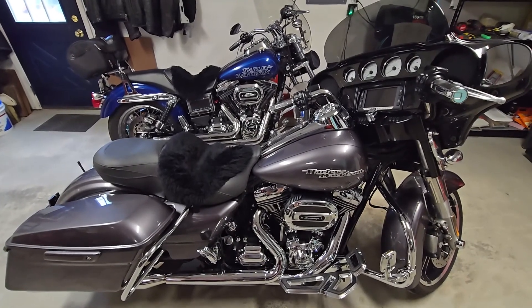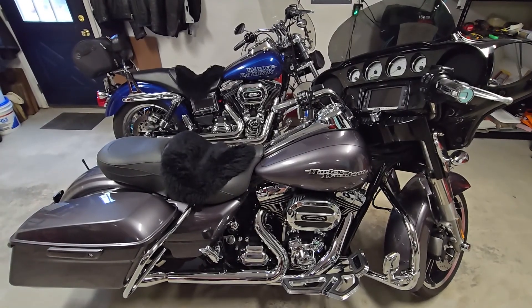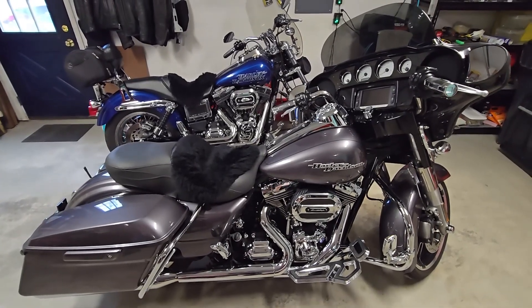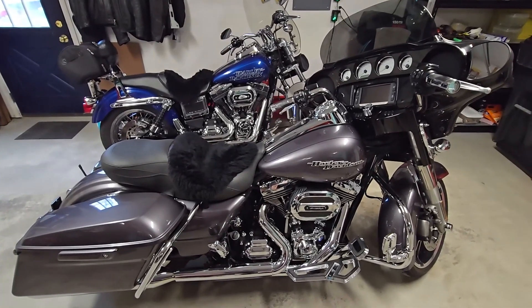The project is done. Both bikes have had a full brake flush of all the calipers. The HCU was actuated for both front and rear, and then they got another full brake flush. So I am done for two years. It was very easy using the ITM HD2. I highly recommend it.